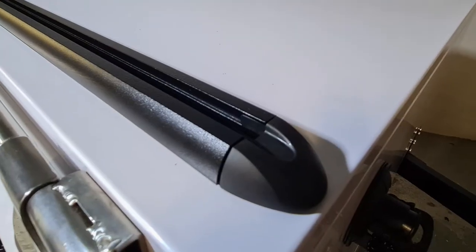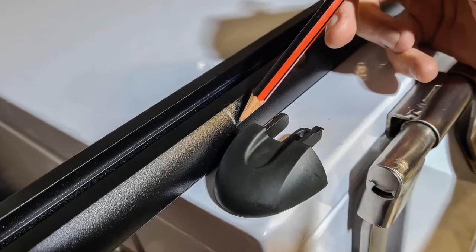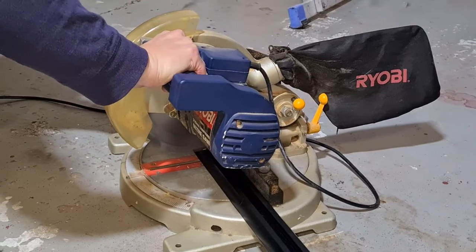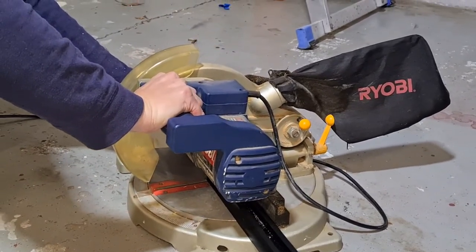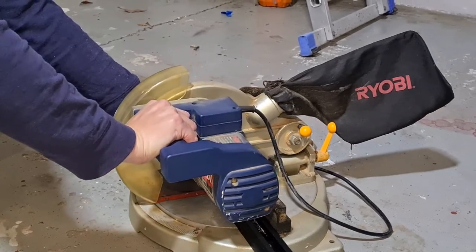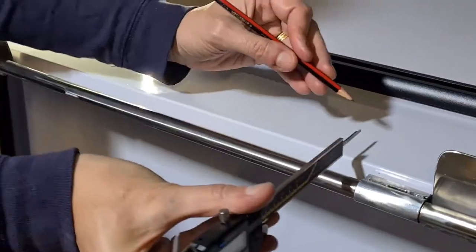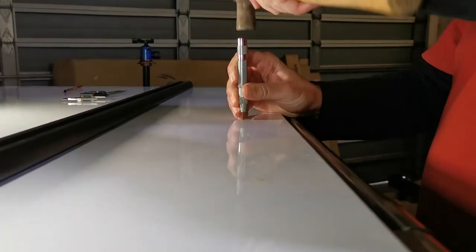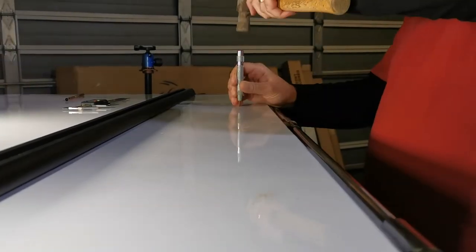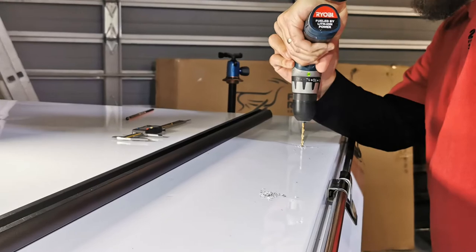We started off by carefully positioning and measuring the canopy tracks to determine the length needed. Then cutting to length with the cutoff saw, which has a blade suited to cutting aluminium. Then we carefully measured and marked up the fixing positions on the Genie and used a punch to mark the drill points, although the punch in this case was something with a sharp point, and then drilled through the roof.